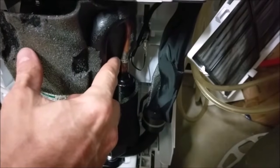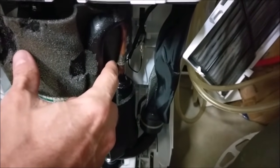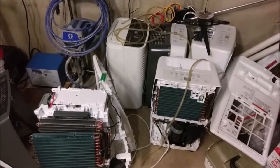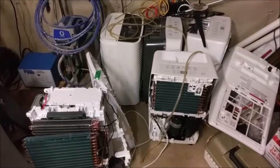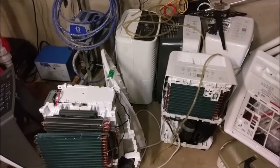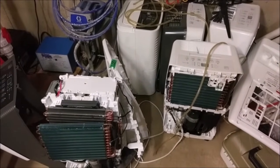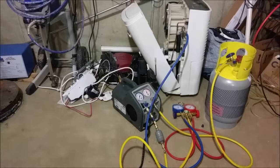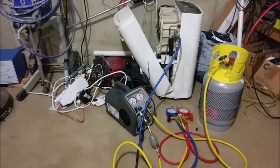Sometimes like this one here — I think it lasted about two days and the pipe fractured right there and spit all the oil out onto my floor. So I called them back and they said sure, we'll send you another one. That one lasted about a couple weeks. Now here I am with one, two, three, four, five — my sixth dehumidifier is starting to freeze up. I'm going to see if I can take this collection of parts and make one good unit, because I have basically six donor units now. I'll always try to recover the refrigerant by putting a service valve on, but usually these things don't have anything left in them anyway.